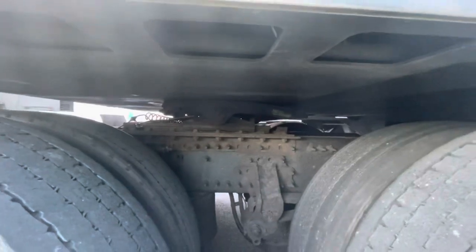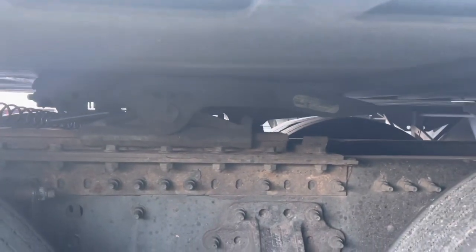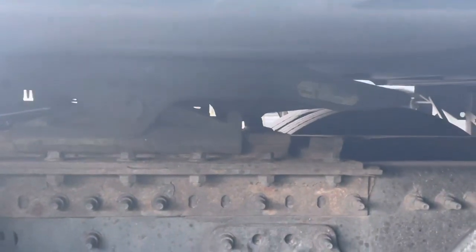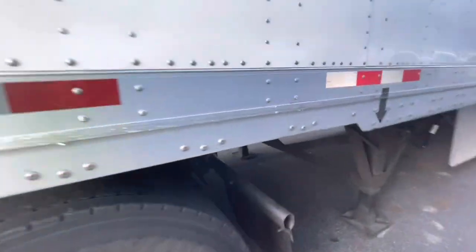We're going to go down here to the space — you can see there is no space between the trailer and the fifth wheel. The pin is inserted in; if it were not properly in, the pin would be pulled out still, meaning it didn't click in. I also like to check the actual lock on the kingpin. The video may not show it clearly but I verify it with my personal eye.